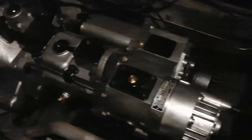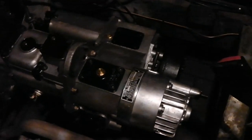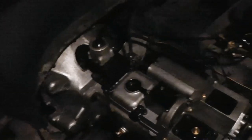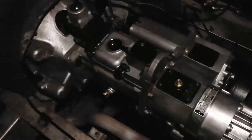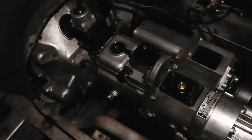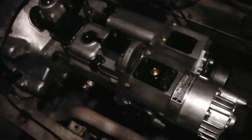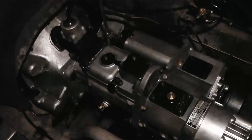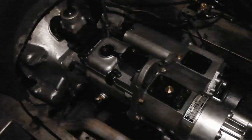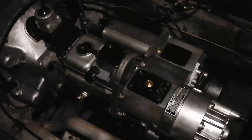Having got all this together, filled it up with oil, I thought I'd just have a little test run. Everything works - you can get high and low range, four wheel drive, pops in and out fine. But if it looked like a struggle getting the gears, it was. I've adjusted the reverse detent correctly but it's just like the last one - very tight - and it's actually just got better while I was sat there taking it through the gears. I was being a bit violent with it. I found last time that once I'd selected the gears a few times running like this without the props, it all freed up a bit. It's slightly disappointing - I had hoped it was going to be easier than that. Of course when driving on the overrun the gearbox will still be turning and it'll be a lot easier to get the gears. The clutch doesn't appear to be dragging, which is good, so the adjustment's about right. I think it's going to be a case of just going for a long drive and struggling with it a bit at first till it frees up, just like last time.